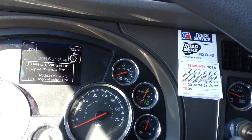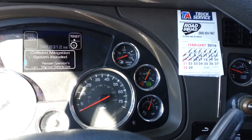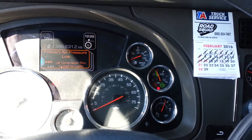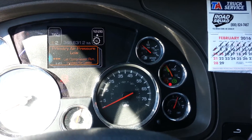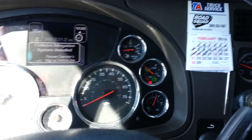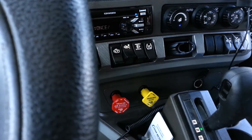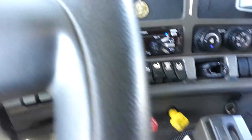Now your brake integrity test — well, it's the same thing. But another test you can do that kind of ties in with it is you want to see if your alarm goes off at 60 PSI, which mine just did. If my truck was running, it would be beeping. Once you get down to about 25 PSI, your brake should pop out. There it goes — bam. And that happened right as I was at 25. So that's how you know your emergency brakes work and your air system's good.